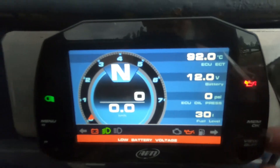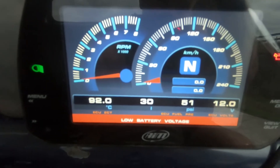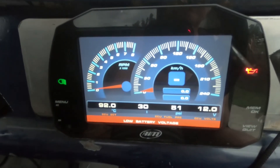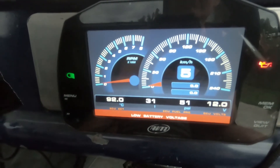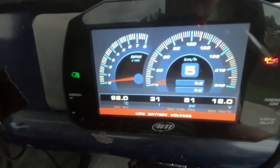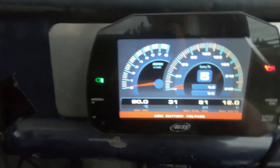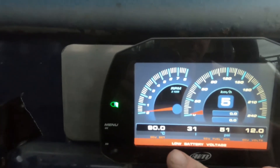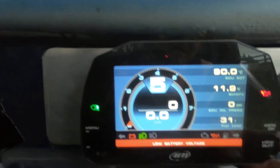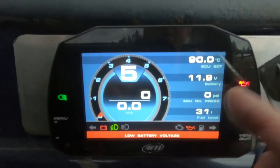These are legal in New Zealand. For that you do need an odometer, so we'll flick through a couple of screens. Here's the odometer and the trip meter. This one's got a gear indicator — doesn't do park though. There's reverse, neutral, and fifth gear. Need a little bit more setup on that Link computer to get those gear readings better. And here's our fuel pressure. We've got oil pressure on another screen — oil pressure is coming from the Link as well, going through the Link ECU and then through the CAN channel up into the dash.